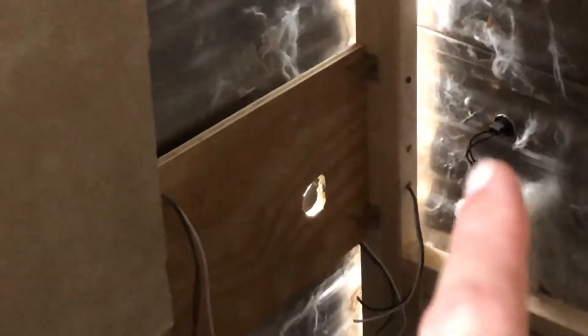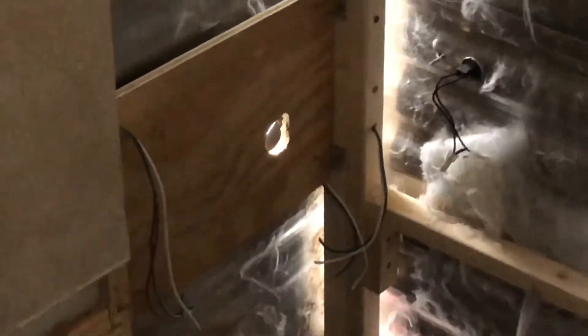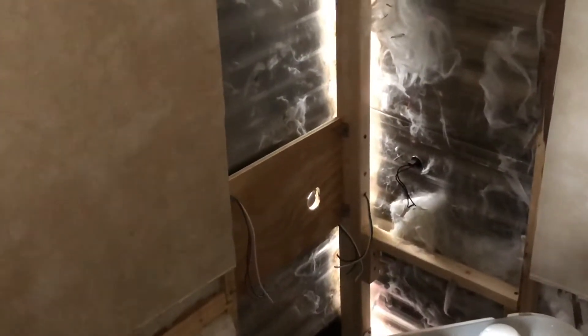As you can see we have a lot of wires just kind of hanging everywhere. Over here is the clearance light and then the brake lights back there — all these wires end up going into those wires and then this side goes to the clearance light. But I think I'm going to get longer wires for the ones that go to the clearance light, because once everything is wired together there's not a lot of play. So if I ever had to do a different taillight or something, there's not a lot of give with the length of wire. So I think I'm going to get some longer wires before I get that all put back together.